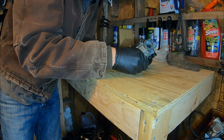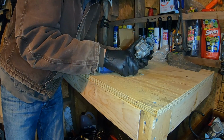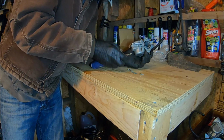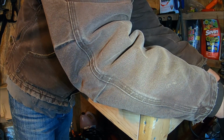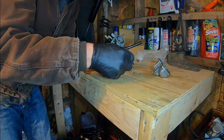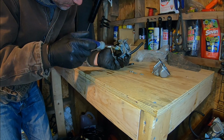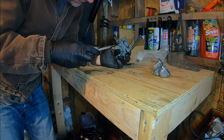With the hanging RPM and stalling out coming off of the throttle back to idle, that makes me want to have one last look at that idle jet before I go too far here. This might be full of fuel. Yep, there we go. You know, there's another option here too, in that I can take the jets out of the Chinese OEM and swap them in here and really use that carb as a rebuild.